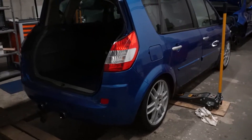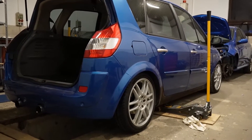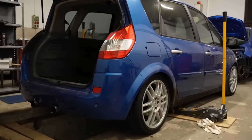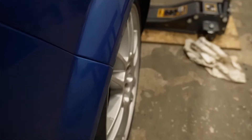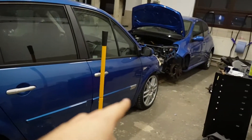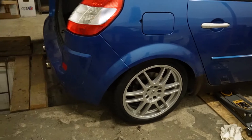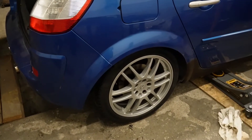It's Friday and the rear is on the ground. Two things: one - ride height is great, spot on, exactly the same as the front. Second thing - rear fitment is absolutely terrible. So I'm heading home to grab a pair of wheel spacers to put on the rear. We also noticed something: original Scenic bolts were M12, RS bolts are M14. The Scenic rear discs I got - just 5x108 - turned out to be M12. So I currently have different bolt sizes front and rear. I'll try to fix it.